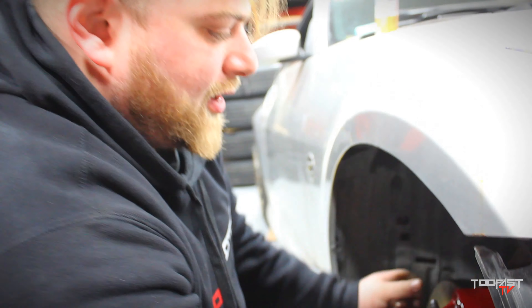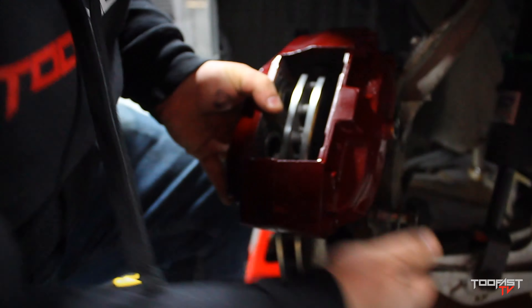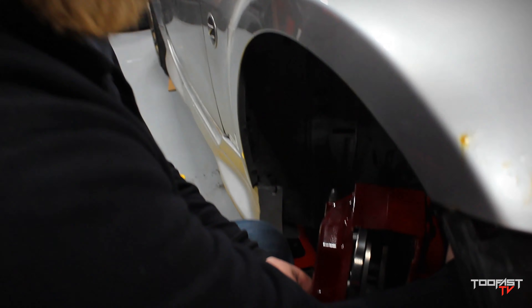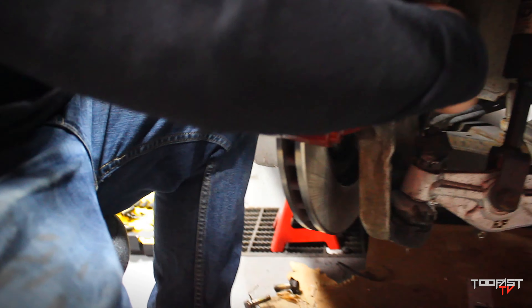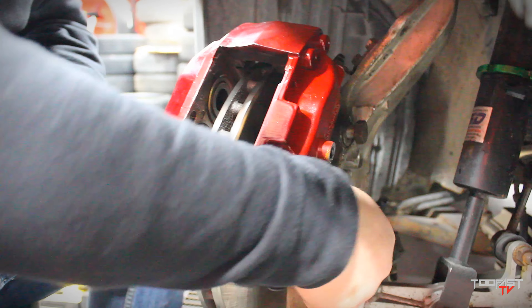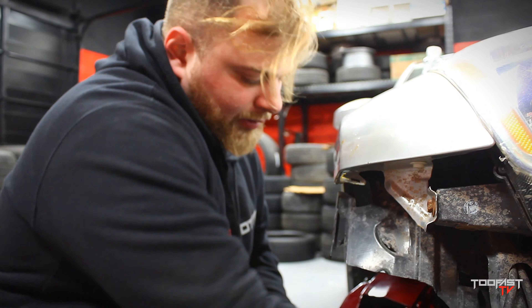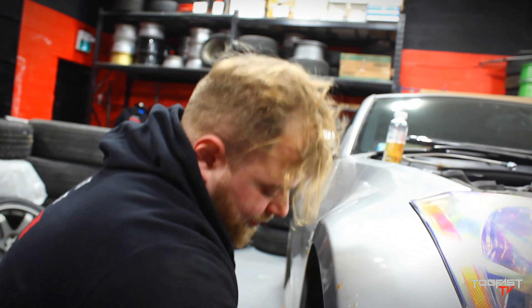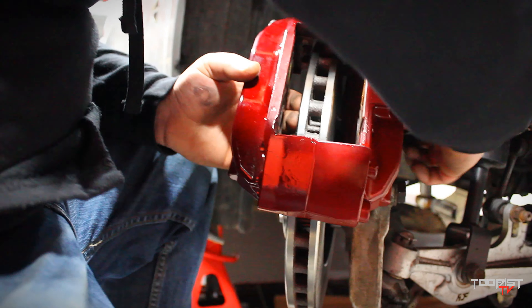Next step: bolting in this beautiful caliper, hand-painted by yours truly. I know I was gonna send it to our body shop but I'm very excited to start drifting. So what we're doing right now — we're bolting in the caliper, just two bolts in the back of these Brembo calipers. Very simple. But don't be fooled — you have to make sure you install the brake pads properly, you gotta make sure all the pins are lubed in properly and fastened properly, which is the most important part. It's not just bolting in the two bolts for the caliper carrier — you gotta make sure everything is moving freely and that your brake pads don't seize to your rotor.